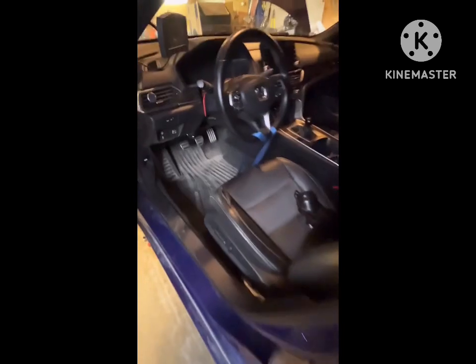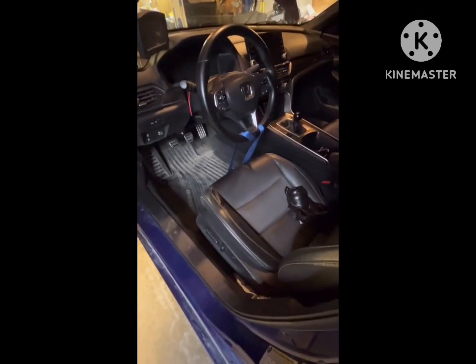You're gonna pull up on the steering rack. It has like a slider, and it slides over here. Like, you can't misalign it. And what I do to hold it, I use just a tie down. I don't know if you're gonna be able to see, but this piece moves up and down. It's a slider, and then there's a 10mm bolt that goes through it. And then this cover is what covers that. You just literally pull it up. It's just clips that hold it in.